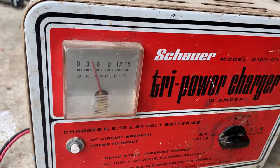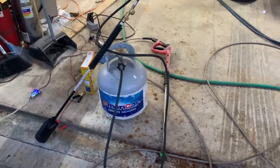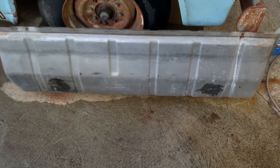All right, getting close. And now we wait. Time for the final result. Pressure washed several times, used my sacrificial rod — which you can see laying there — and a pile of rust, which was huge. Then heating it with a weed burner to get rid of all the extra water in the seams, right where you can see the pinch weld. You have to boil all that water out or it'll be in there when you try to waterproof the tank. After I let it cool off, I'm going to splash some Marvel's Mystery Oil all over the inside of it — give it a couple spritzes and I think it'll be ready to reinstall.